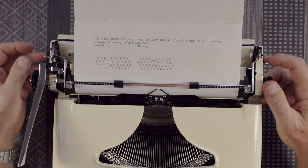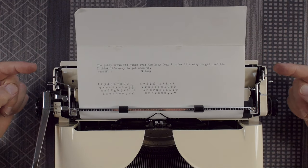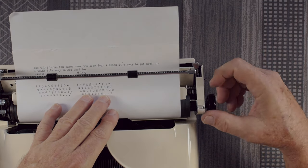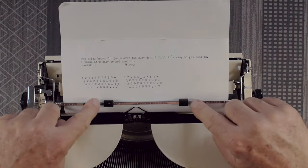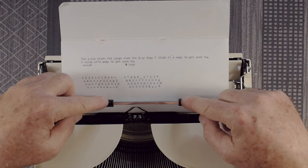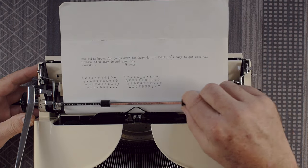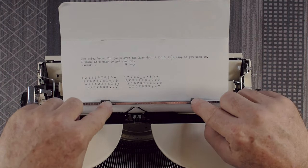On the right side of the carriage, there's a carriage lock lever — pull it forward to release the carriage. This is a full locking lever system that protects the escapement when shipping the typewriter. One of the nice things about this machine is it has a carriage release lever on both sides of the platen. You have a tension release lever for the feed rollers and a paper bail with a paper scale on it. Underneath the paper bail are two rollers that are basically plastic, not rubber. The problem this one had was the right-hand feed roller wasn't touching the paper properly, so it was easy to slip — I had to reform the brackets to get both feed rollers to have equal tension on the platen.